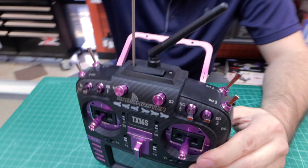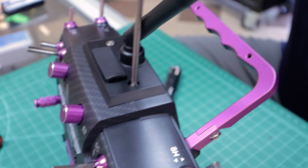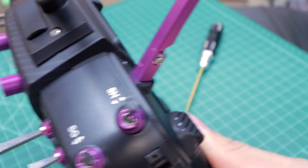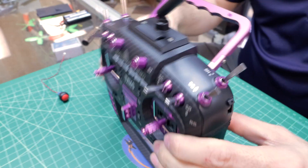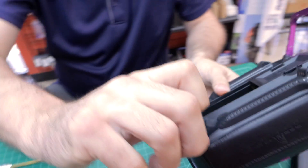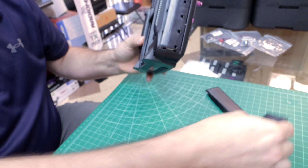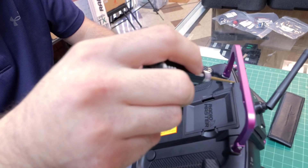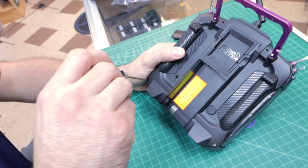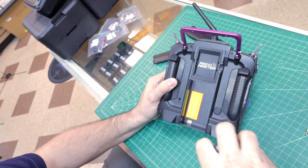Go ahead and take the 2.5mm at the top. Back it out until it's a little past flush — you don't have to completely remove the screws, just back it out a little past flush. There's usually about a turn there, that's enough to get up over those tabs. Then we're going to take our 2mm. First we've got to take the side grip cheeks off — just literally get your finger in there and pull it out. Now we've got the grip cheeks off and we have four screws to remove here — top two, and then here and here.